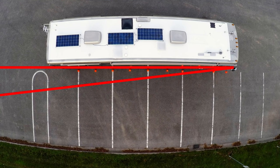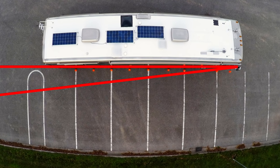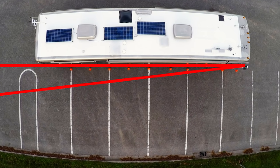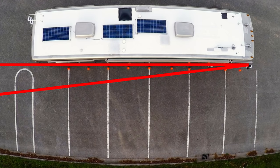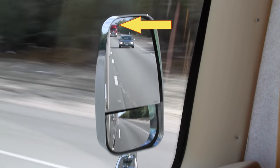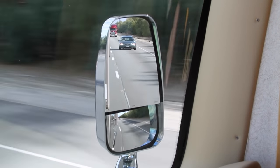If there's an awning on the right side of your rig, you might be seeing the awning arm instead of the paint job. Just make sure that you can see part of the RV in the edge of the mirror, guaranteeing that no one can slip between your view and your rig. This is a correctly adjusted flat mirror, with the horizon visible near the top and the awning arm on the side of the RV just visible at the edge of the glass.